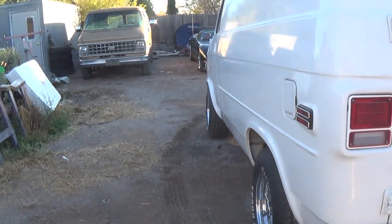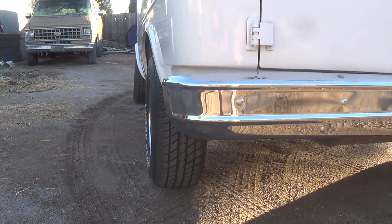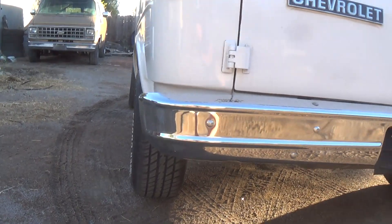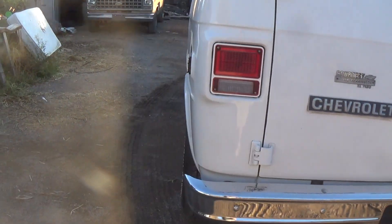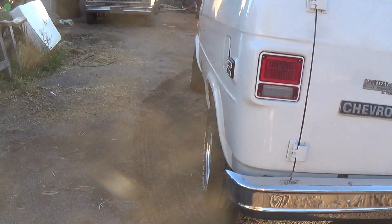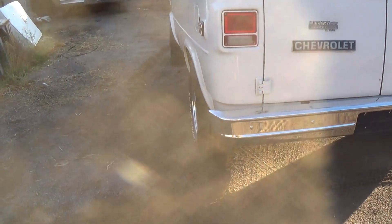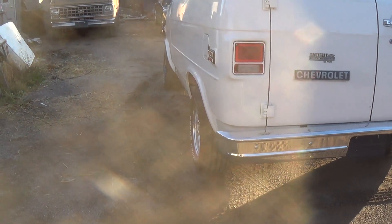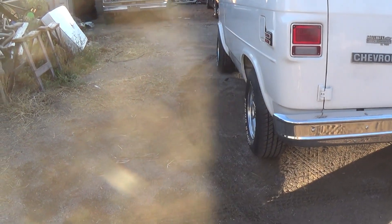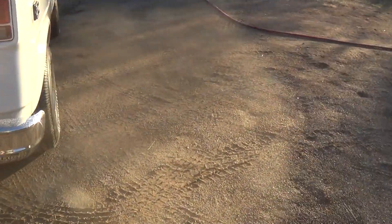You can probably see the negative camber better from this angle. It's actually quite a bit — if you can see it with your eye, that's significant. It'll wear out the inside tread on the tire. I could probably get it aligned and that would correct it, but the half-inch variance from driver's side to passenger side is still too much, and the fact that the tire rubbed the fender well is not good either.